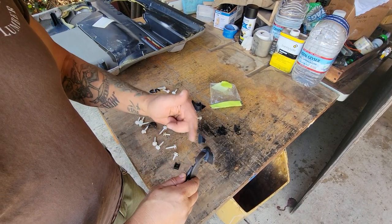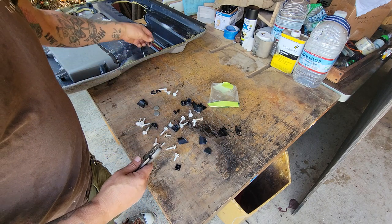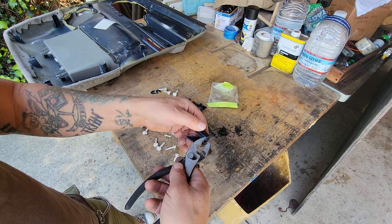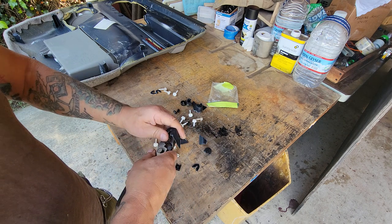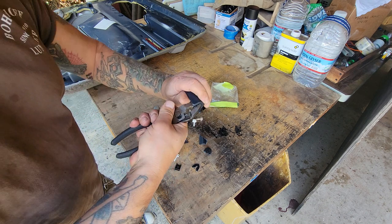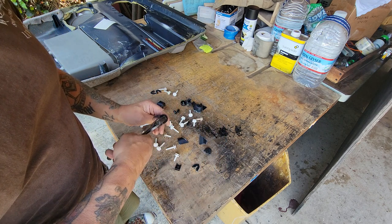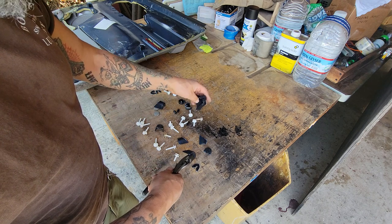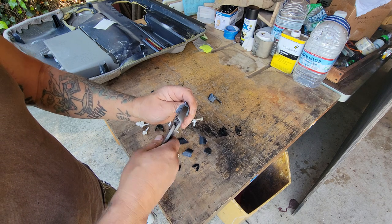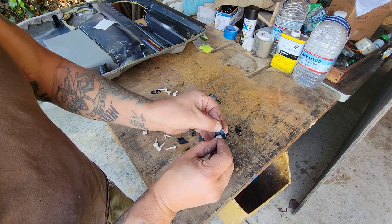This is an experiment — I grabbed this with a pair of pliers, busted that off, and look at that — that gives me pretty much exactly what I need to glue onto the other door panel. Let's do it in real time — I'll get the pliers in here and bust this off from the inside first to give me a little more room. Let's just grab it. The other one was easy but now I'm going to have a hard time. You need a couple of them. There we go — that just ripped off of there. Adjust the pliers, bend this out, and now I've got another one to JB weld on top. The white clip slides right in there.